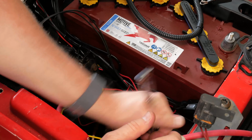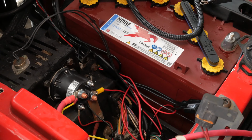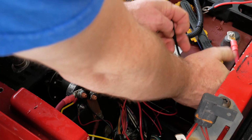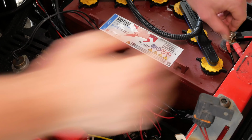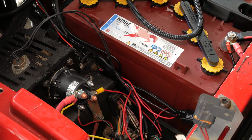And one last thing I was going to tell you, the reason I had to replace ours wasn't because our golf cart wouldn't go all the time. It's because frequently in the middle of wherever we might be, it would just stop. It wouldn't go, and then we could press the accelerator 10 times, and maybe 1 out of those 10 times it would start working again. So we replaced the solenoid, and we've had no trouble since. So that's another symptom you may see.